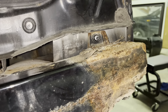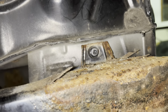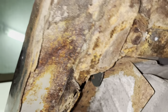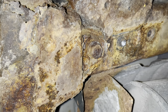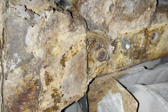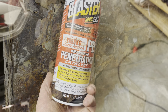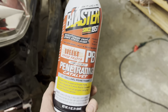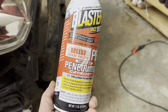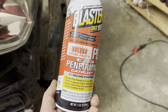With the trailer hitch removed, we now have access. There is the top bolt to remove on the right-hand side, and then there is the 17mm bolt underneath. I'm going to put some heat and lube on these. I'll hit all four bolts with some PB Blaster penetrating lube to see if this helps loosen those bolts up — I don't want to snap any of them.